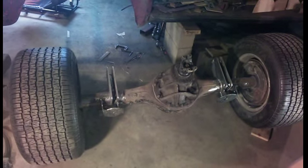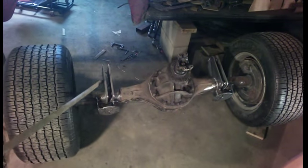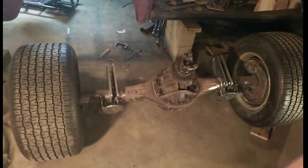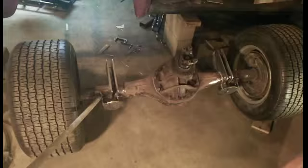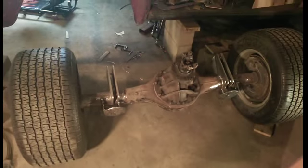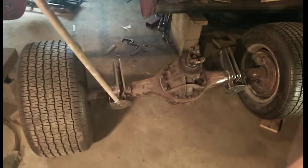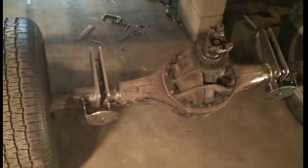What I did was I put these flanges on before, and then I added these triangles back here, and stuck on the flanges for the sway bar. I also made all these pieces to hold on the spring seats — or to hold on the air springs, the airbags. I had to leave enough room to get my hand in here and get a bolt right in there to bolt the airbag onto the top of this.